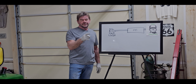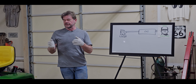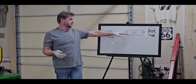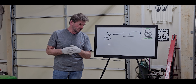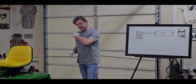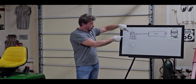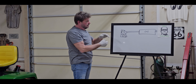It made a huge improvement. It still kind of drives like a boat compared to a modern machine, but it's nothing like how they came originally. I'm not sure why the steering ratio is so slow — it's not like the thing weighs 10 tons. You can do this modification to your 330 as well if you feel you have sloppy steering. Start all the way at the rear of the vehicle and work forward, and the last stop is modifying that bracket — make it as close as possible to shorten the moment arm and get maximum response with the same cylinder stroke.